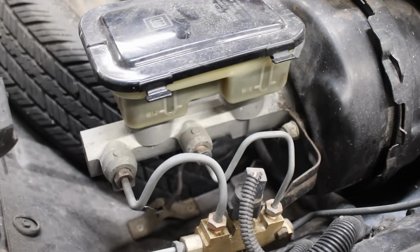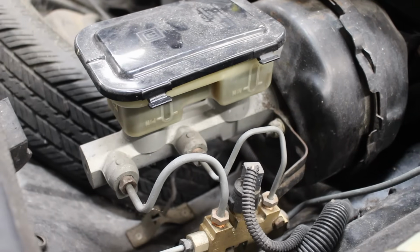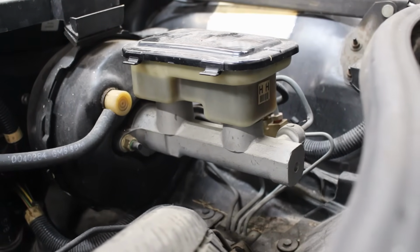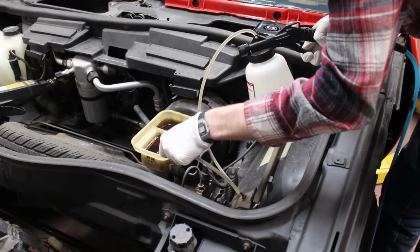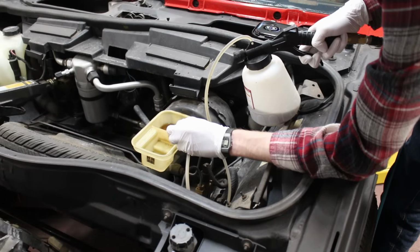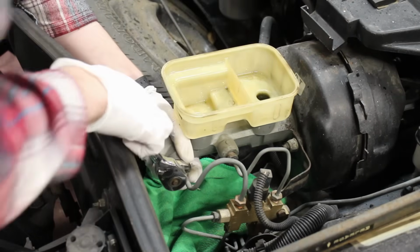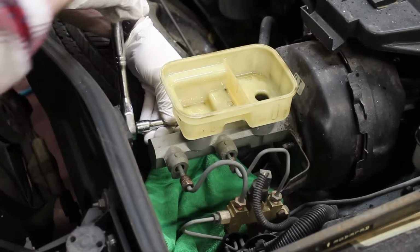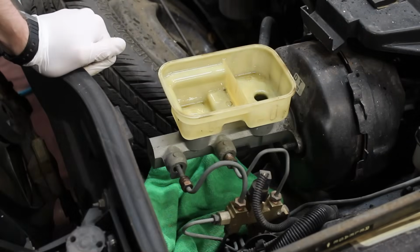The brakes were the very first thing I rebuilt on this car. And when I say brakes, of course I mean just the brake calipers. I've been getting away with using the original master cylinder with 36-year-old seals. Now, they have been working perfectly, but truthfully, I've only driven this car less than 100 miles since getting it running. It's pretty much lived most of its life in my ownership in this barn. There is no telling how these seals will hold up long term, and it doesn't make sense to find out, especially when rebuilding this thing only takes about half an hour.